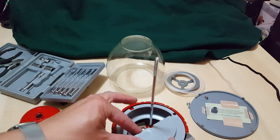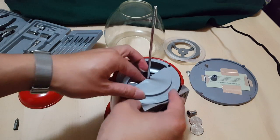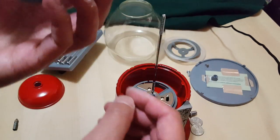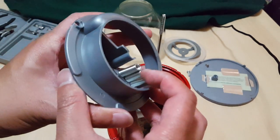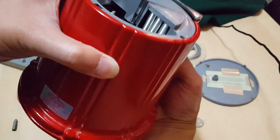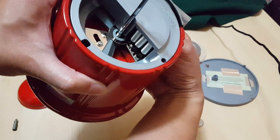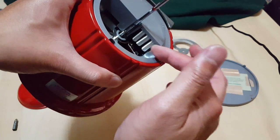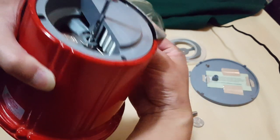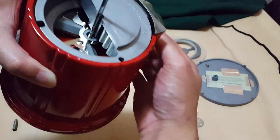Right after that I actually didn't find any bolts in here — this goes right on. This is actually the hopper, or the hopper mechanism. It has instructions with top and front marked on it in case people working with it won't forget. There's a spring for the doors so that as it moves, the hopper fills and pushes in and makes it rotate. This keeps it from overfilling. With a coin in it, it moves to the hopper and your M&Ms or gumballs get blocked by this and fall into these little cavities — these little hopper holes.